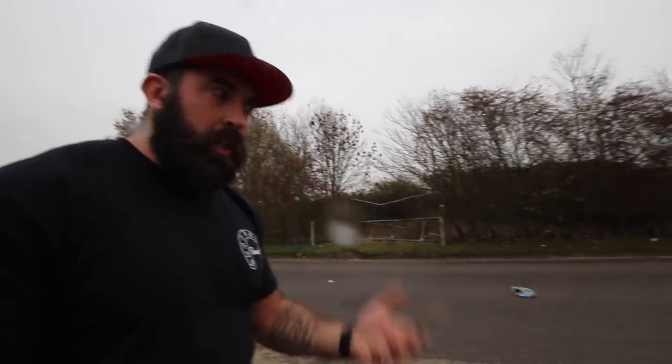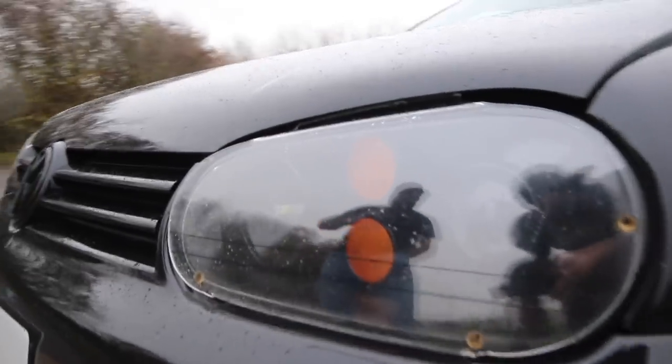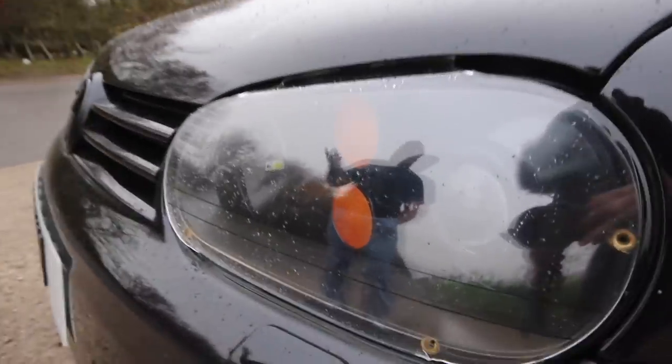The bonnet raiser is mainly useful when you're stationary - intake temps get really high. A bit of air gets through anyway but it mainly just helps get heat out of the engine bay. Then the headlights - all R32s in Europe came with Xenon as standard from factory, but these are LED projectors now. A friend of mine who modifies headlights took them apart, stripped them, and fitted bigger projectors with the proper LED system. They do get a bit of misting because they've been split, but on the road they're fantastic - way better than Xenon.